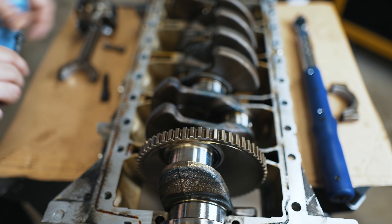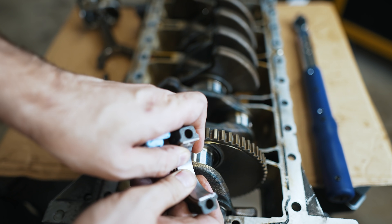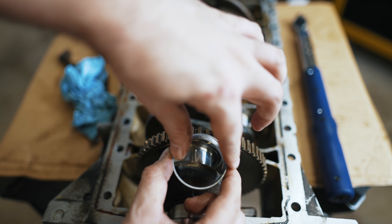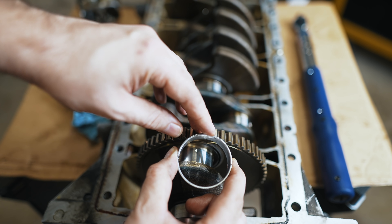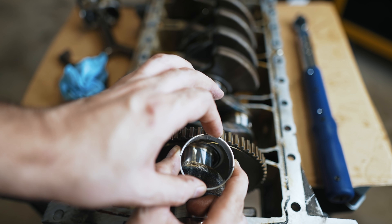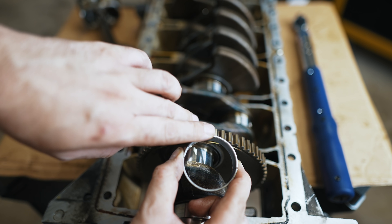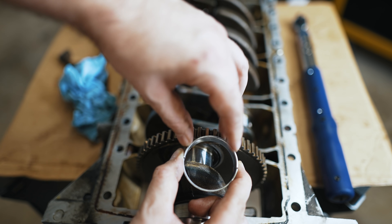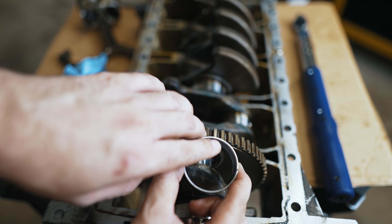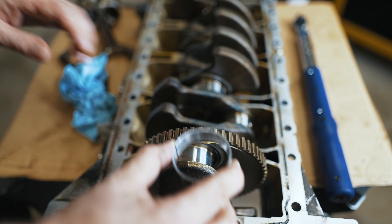Use some brake cleaner to clean this up. Since these bolts have already been stretched a couple times, I'm going to get another set and extract these bearings. Something you may not know about these bearings is they're not a perfect circle — they're wider at one point and narrower at another. The idea is with centrifugal force, they'll spread out at high RPMs or heavy load and make a perfect circle under load; otherwise they have kind of an elliptical shape by design. If you don't have enough clearance, this isn't able to fling out of the way, so you don't gain enough clearance and it could contact the crank at high RPMs or heavy load, etch itself away, and spin the bearing because it gets too thin. That's your point of failure, probably starting on the upper side.